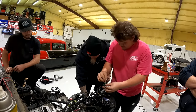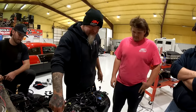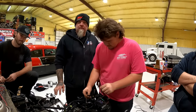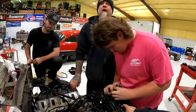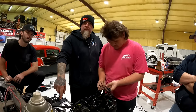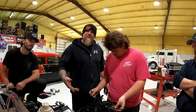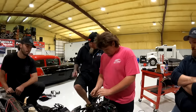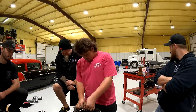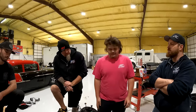Crank. Okay, then, so then that goes, obviously, right here. Yep. Cam and crank. And then there's gonna be one that says cam. It's above the starter. That's crank sensors above the starter. The cam will be in the front, and the crank sensor will go down to the crank trigger. Which one's the one above the starter? That's the crank trigger, or the crank sensor. Oh, we're not using that one now. Oh, well then he can put the starter on it. Yeah. Air temp's the sensor in front of your intake that you still need to pull out and seal up. H2O. Also known as water.